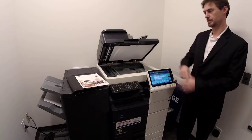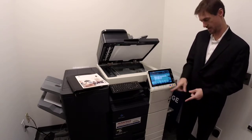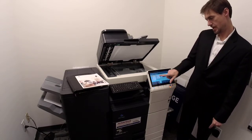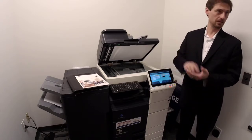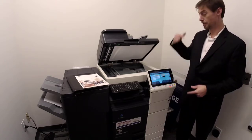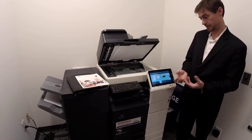If it's beeping at you and you've got 10 color pages to send through email, hit file type after you choose color and hit compact PDF. If you haven't chosen color, it'll beep at you because that's all that function is for. It'll take a little longer to send, open, and print, and the quality isn't great, but it will reduce the file size significantly because it's compressing it.